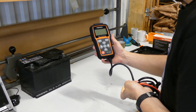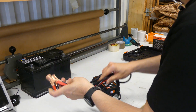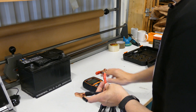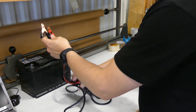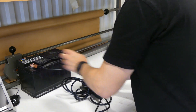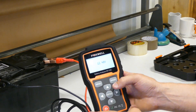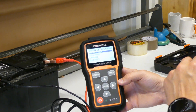This instrument is not self-powered — it's always powered by the battery. It has a cable with clamps: the black one for the negative terminal and the red one for the positive terminal. Always make sure you connect it correctly. In my case, the positive terminal is here and the negative terminal here. Once connected, it beeps, shows 'battery analyzer' on the screen, and will display the current voltage of the battery directly.